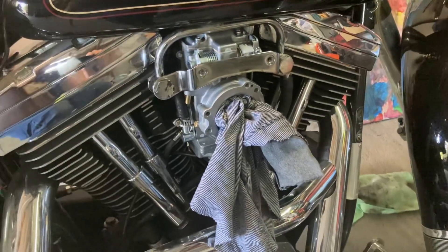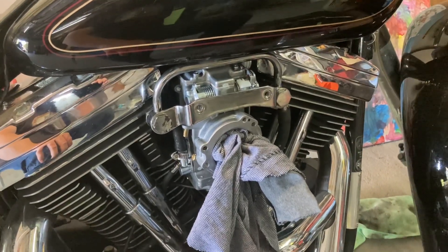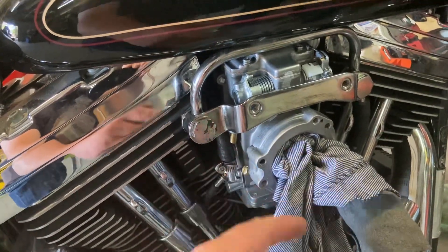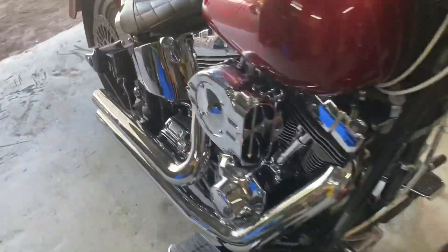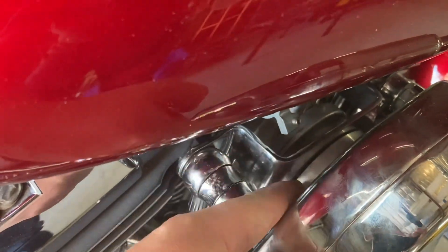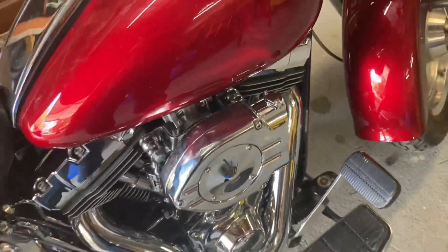As you can probably tell, it's the next day. The phone died last night on me so I couldn't finish off the video. We were chatting about this carburetor. As I said, the bike is up and running. I'm having problems getting the air breather and stuff to work with it, so I need to buy another bracket. I went online this morning to Rulli's Speed Shop and ordered one of these brackets that sits in front of the carburetor. You bolt the air breather through it and into the carburetor, and then it's all bolted to the bike so it won't blow off in the wind.